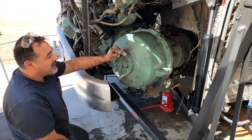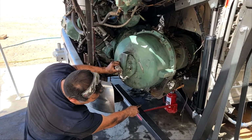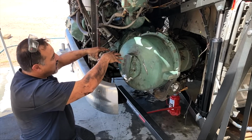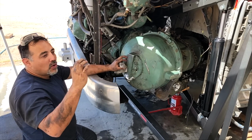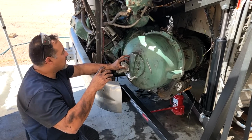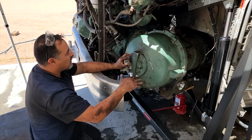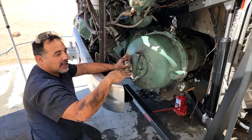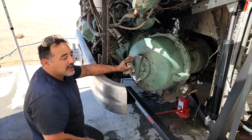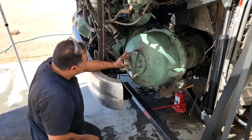So it's back in. It was a little bit of finagling to get it in there. We used just a bottle jack on the bottom with a 2x6, because when we got it in initially, the holes were off by about 2 degrees. We put a bottle jack underneath the nose part of it so that it turned clockwise till we got the holes lined up, and then they literally slid in by hand. So they all went in really smoothly and really well, so we're thankful for that.